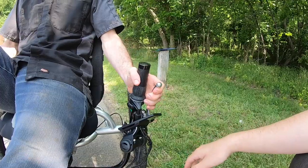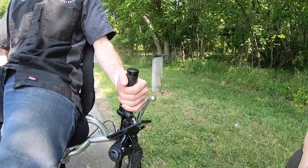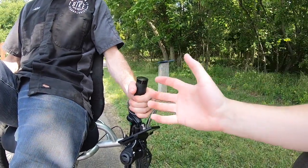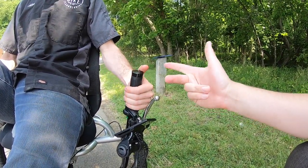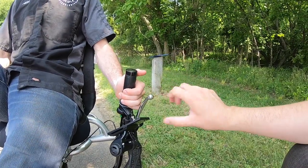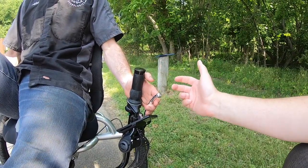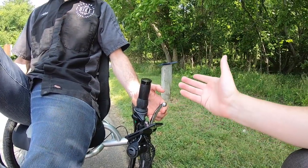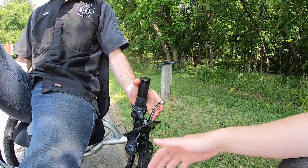All your controls are mounted in a position that feels upside down compared to a normal bike. The brake lever has a really long handle so you can actuate it with your entire hand, which is good. You have a SRAM 3.0 grip shift for both front and back. These are a little tough to access because you have to use your two weakest fingers — your pinky and ring finger — to shift. So if you have arthritis or similar considerations, it might be a little tough.